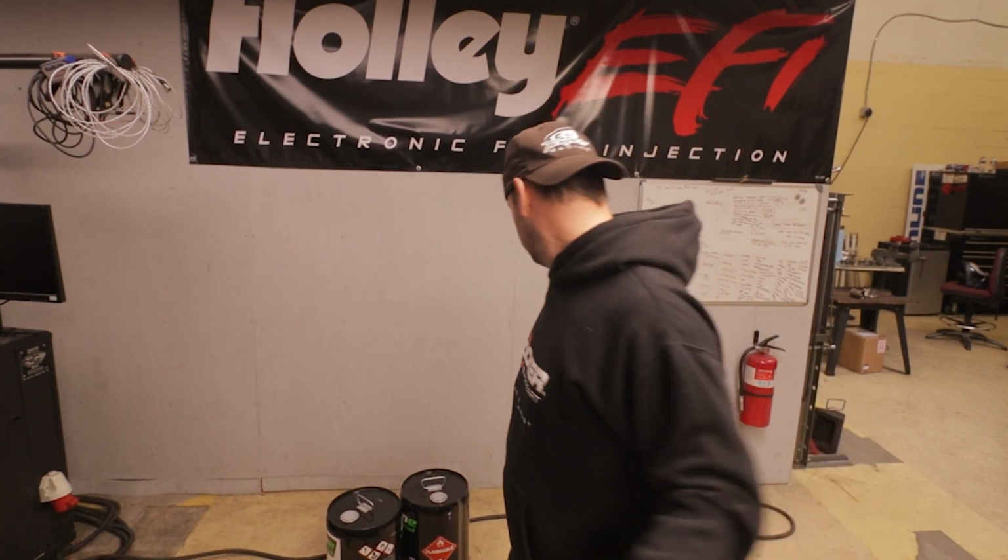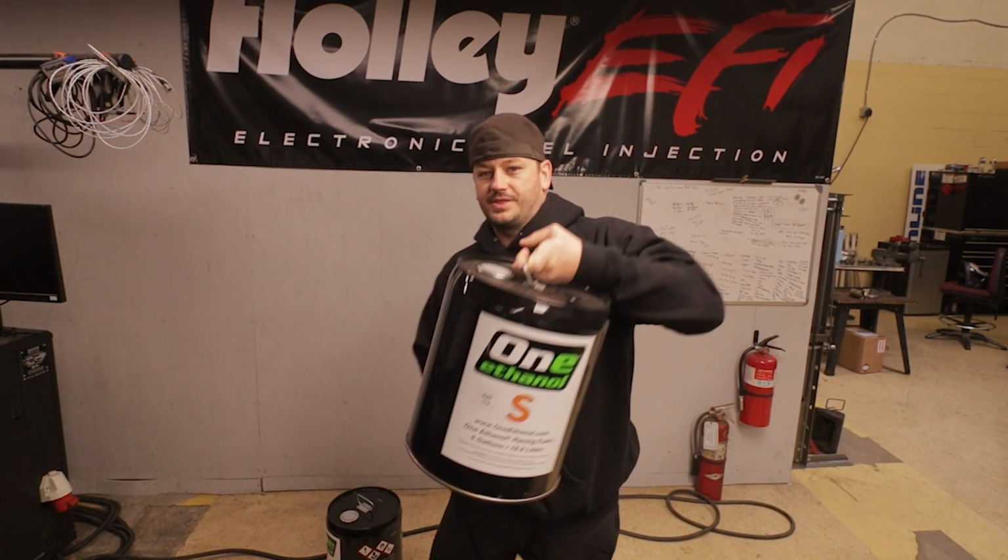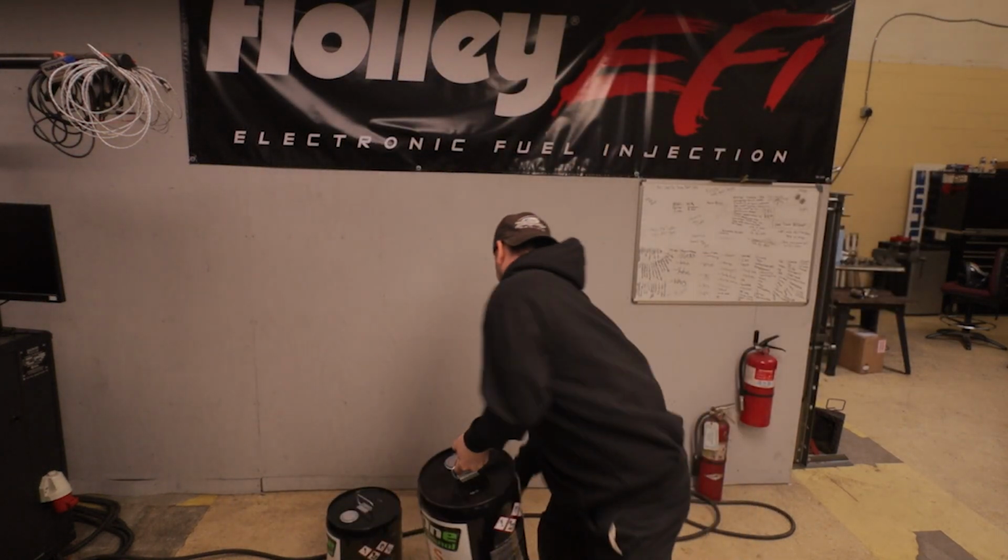So long story short, we made it right to like 590 something horsepower on Friday. Trying to get it over that 600 mark without turning the boost up any more, I kind of didn't want to put any more time in it, but it was late. I had to get out of here, so I just called it quits there. And the real deciding factor was we're out of gas with the 93 octane that was in it. So I was trying to make it to 600, but couldn't do it. So for today, we're gonna throw some ethanol in it. Set it back up on the dyno.